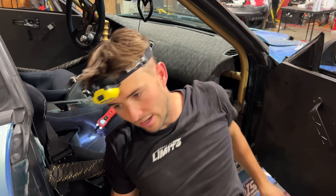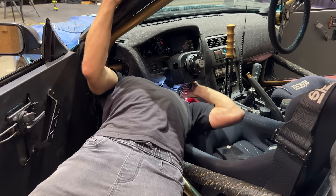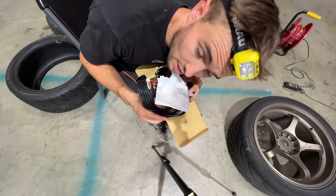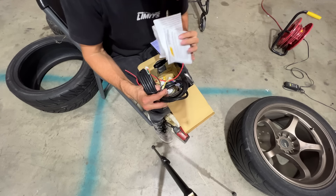I didn't find anything on the other side — it's a lot tighter in here. I'm just trying to find power for the AEM stuff now. I don't see a main power. I feel like I might just do a crab claw tap there to get power, but that's not my favorite approach. I'm using the phone to look at it. I'm realizing I might need to do a relay, but I don't think I will because it's such low amperage I could just piggyback off something else — though that's not the right way to do it. I'll have to read the directions. Right now I'm temporarily setting this up because I'm going to be doing an aftermarket dash that's going to look really cool.